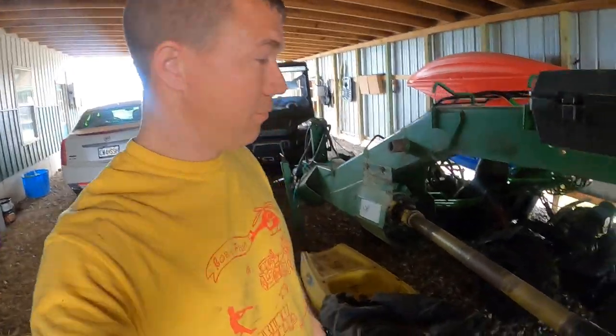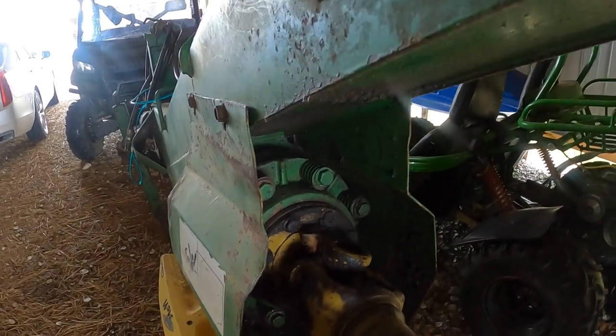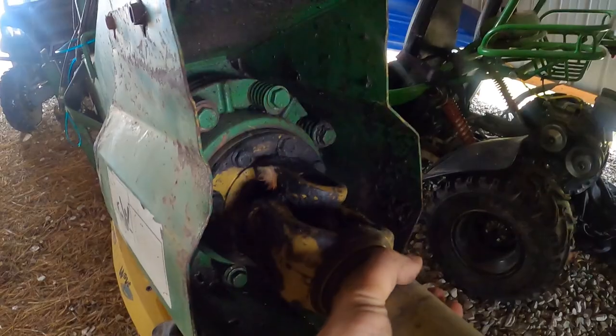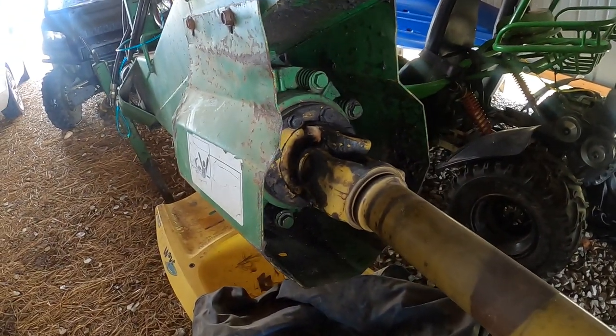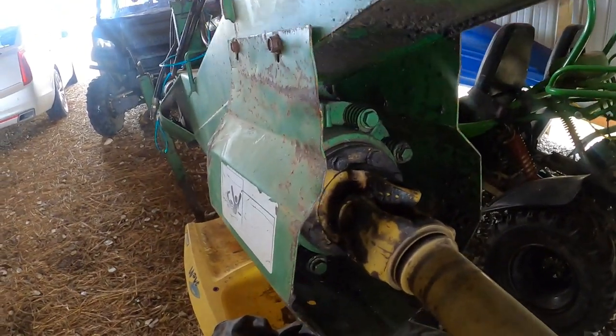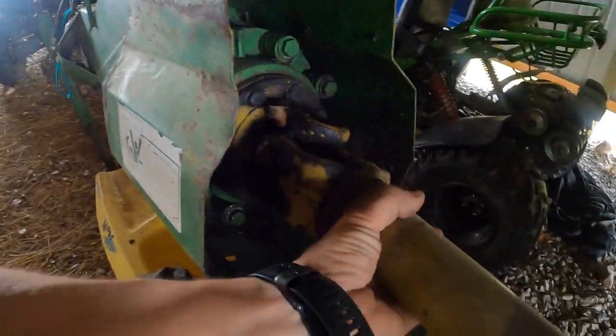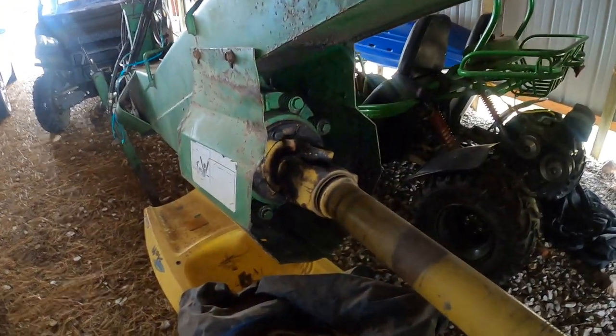Well, hello everyone. It has been a busy week and hay season is literally, like, we're trying to cut hay next week. Only one problem with that. I know it probably didn't help when I'm shaking the camera, but you can probably hear the noise. Shouldn't have that noise. So something's going on in the slip clutch. I'm gonna take it apart real quick and see if I can figure out if there's a bearing bad or maybe a U-joint. But either way, something's not right. So let's dig into it.